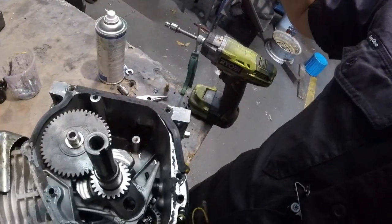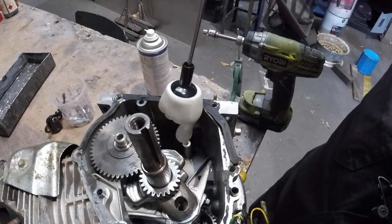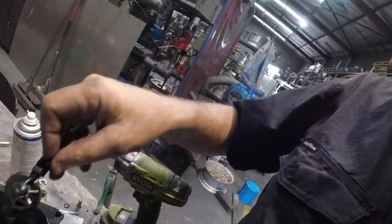I will show you a couple of other things while we're here too. This little gizmo here sticking on the side of the crank — on the conrod — it dips into the oil down the bottom and flicks it up. That's the oiling system, just a flick oil system. The other thing we've removed is this little gadget, which is normally down the bottom — a low oil switch, which on a stationary engine makes sense. But on mini bikes or go-karts with jumps and whatnot, that will cut your engine out. So what people generally do is overfill them to buggery. This one I took the dipstick out and you basically couldn't fit any more oil in it. So that's out now.